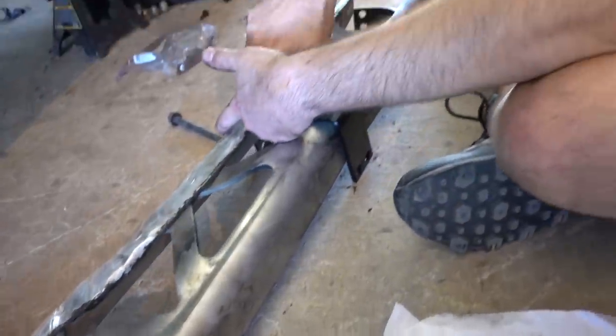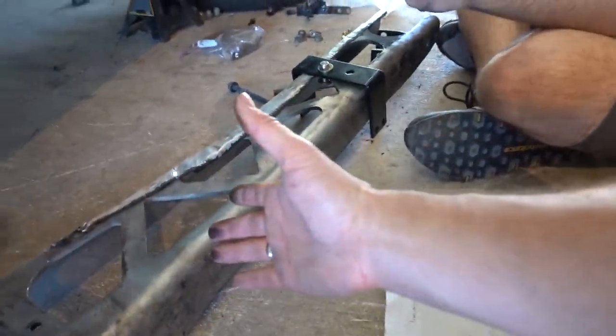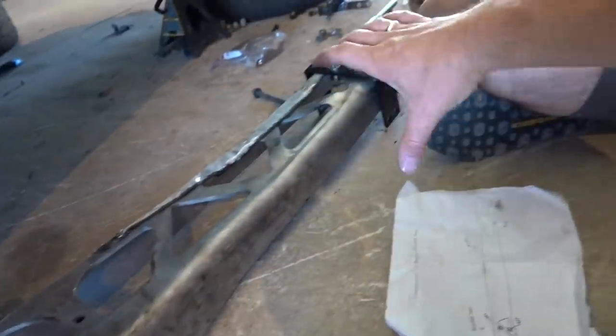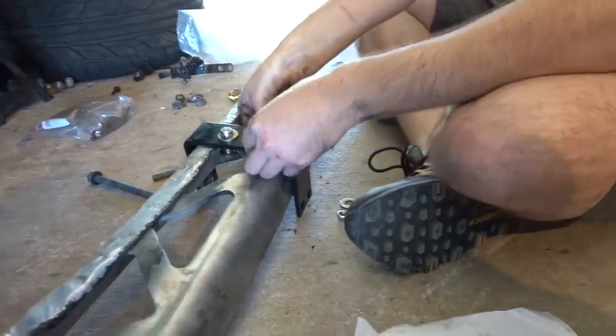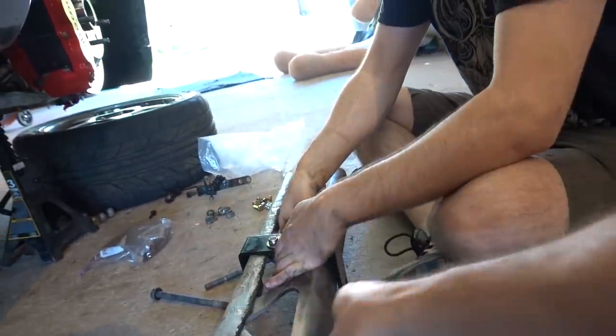This is the C-beam. It goes all around the drive shaft — well, around half the drive shaft. It basically connects the transmission to the rear end just to stabilize everything so there's less twisting. We're putting that drive shaft loop around this side and then the actual loop side of it goes around the other side, so that'll keep that drive shaft all right there.